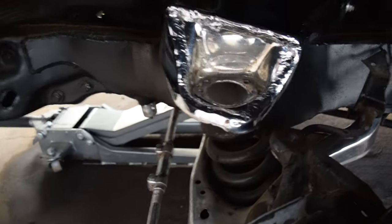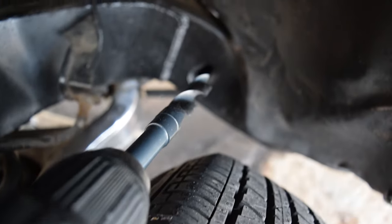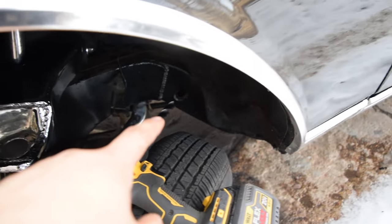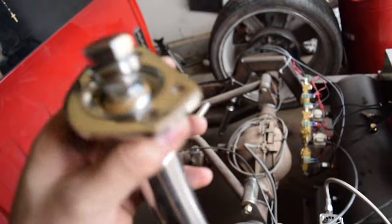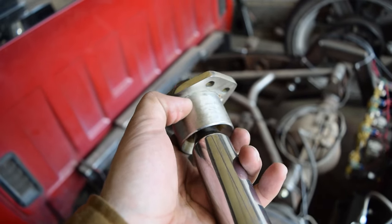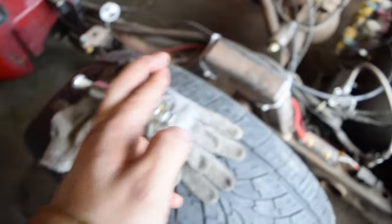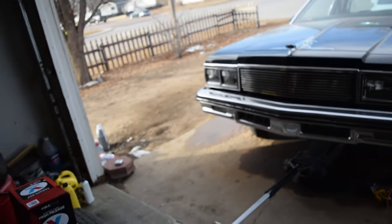Alright guys, so we got the upper A-arm hole enlarged to be able to fit the ball joint. We drilled out our spindle with the 5/8 drill bit, so that works now and this fits. The way I made this hole bigger is with a combination of this drill — just the side of the drill bit running it out — and a Dremel to kind of finish her off. The last thing we're going to do on this ball joint: inside there there's a little ball joint, and we're going to be applying some grease to it, just so that it's nice and free-moving. That way hopefully it doesn't break, boys, because that's the idea. Everyone always says these break.